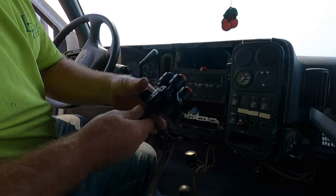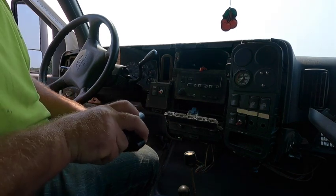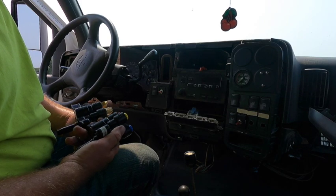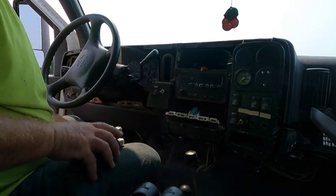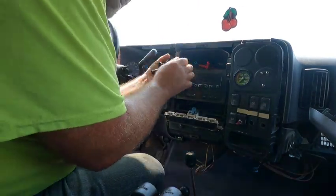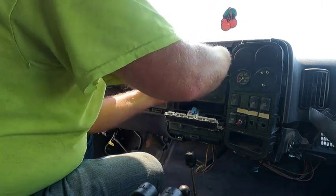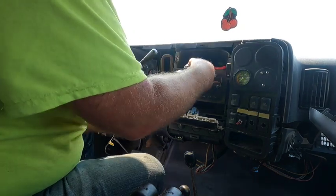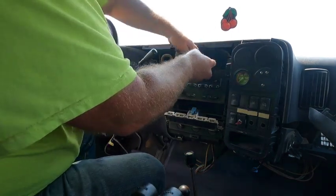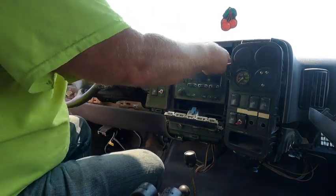I don't know. Okay, well, if you look at this, this blue line, B is exhaust, supply. Says supply 12. And then on the underneath side, supply 11, supply 21, delivery 21. Cool. All right, so we're gonna go off the color codes and put this back together the way it came apart. Yellow, red, which one of those is red and which of them's... Oh, no, that's right. That's orange here. You can see it in the shade. Yep.